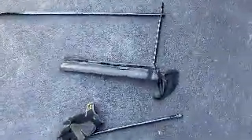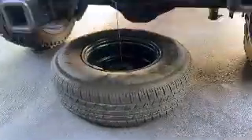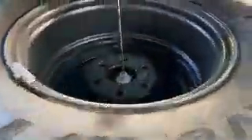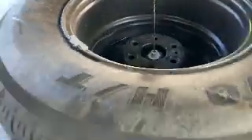In the back of your truck, underneath your back seat, you've got a package like this — not including the glove — that has these different items. You want to get an extension to where you're looking for this piece right here. That piece is what goes all the way into there, and then you have the crank right there. You spin it around constantly, and your spare tire comes down, down enough where you have to take that ball out of the spare tire.